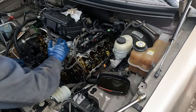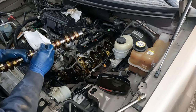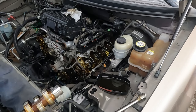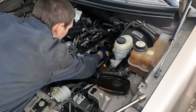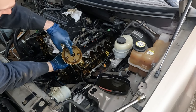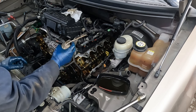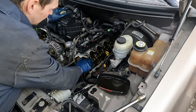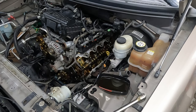Double check that all the roller followers are right in place. Now put our camshaft back in - first clean it off really well, all the lobes and where the bearings go, nice and clean. For orientation our cam notch faces down. To check orientation, take the phaser line that dowel pin up with your notch and see if your timing marks are where they were when you took it off. Now drizzle oil on the lobes and where the bearing caps go for a nice lube job.